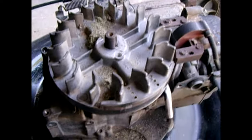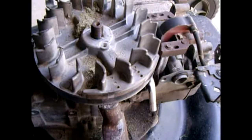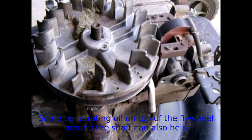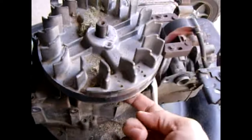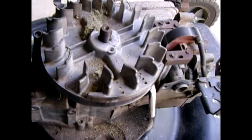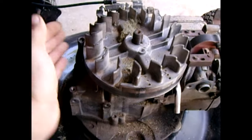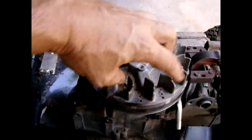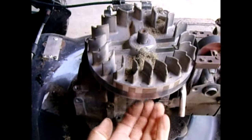Light taps on top are fine. In between those light taps, concentrate on the thick part of the underside of the flywheel — you can hit it a little harder from the underside on the thickened area, on this side and on the exact opposite side. Eventually, between tapping on top and tapping the bottom on both sides, it will pop off. If only part of your flywheel is accessible — like on this Briggs & Stratton — tap here, then rotate the flywheel 180 degrees and tap the opposite side. Keep rotating and tapping.